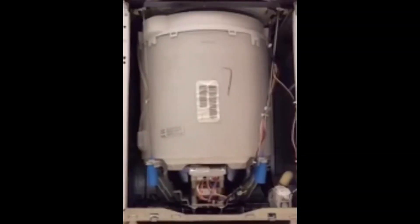How do you know if your machine is unbalanced? If you happen to be around when it goes into the spin cycle, you will hear some pretty alarming banging and pounding noises like this. When the machine is in the spin cycle, it's going pretty fast. An uneven weight distribution will throw the tub off its axis and bang against the inside of the machine.